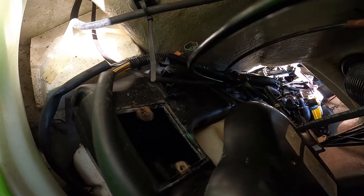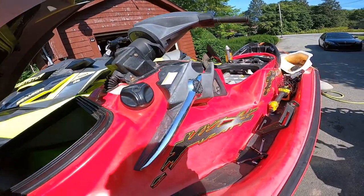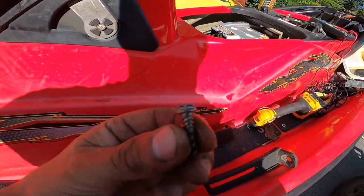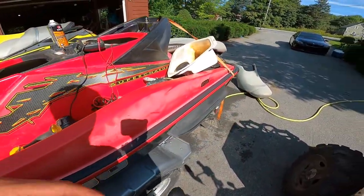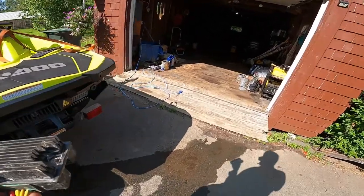So there's only one other thing it can be — my key is good. Down here in the front of your air box, on top of the fuel tank, you're going to find a voltage regulator with two 8-millimeter coarse-thread bolts holding it in. It wasn't exactly rocket science for me.